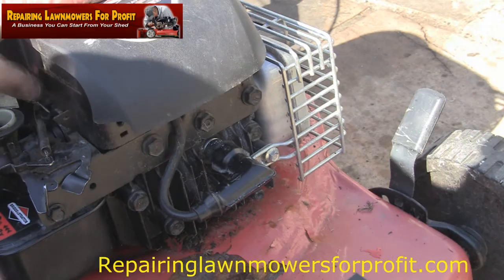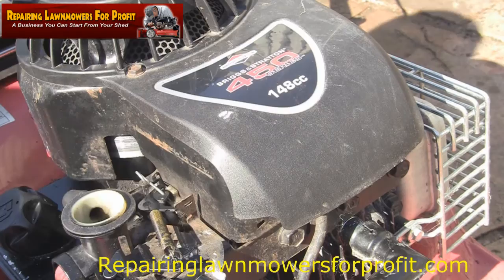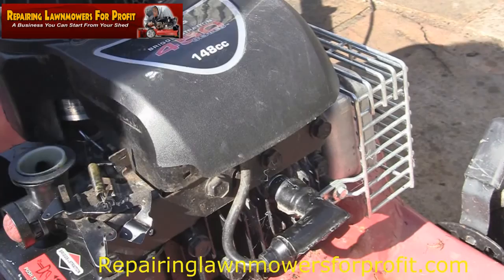I mean, I've got this other one temporarily moving about here. Just pull this in so you can see. I've not got the other one on, but let's try it. It's got some fuel in it. It's got a new diaphragm and gasket in it, and it's got a new plug in it. Check there's nothing underneath it. Lid's on alright. It's all crumbling off, but yeah. Let's see what happens when we try it, just to see how it does run.